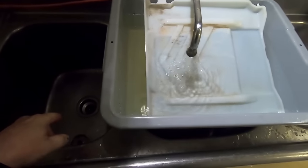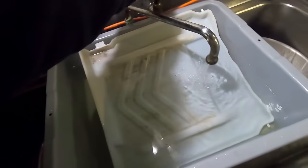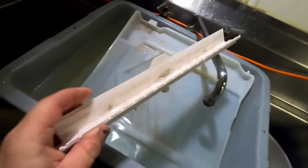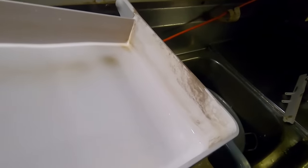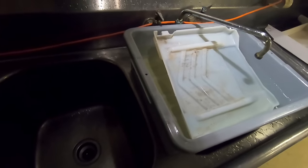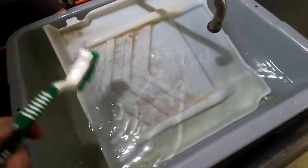We poured the whole bottle of nickel safe in there and we're just going to let the stuff soak. I've scrubbed it and that's as good as I can get it. We've done scrubbed everything we can scrub and although it looks a little better, these are stain marks — this is what happens when you have really bad water. Your water's got to be halfway decent quality to have an ice machine work right. That brown stuff on the side is literally etched into it.